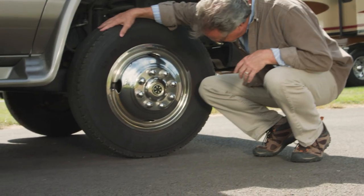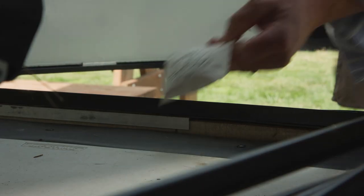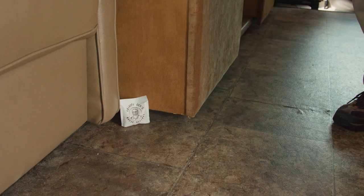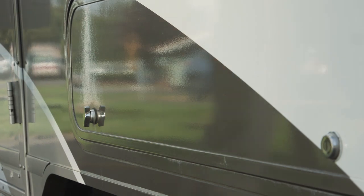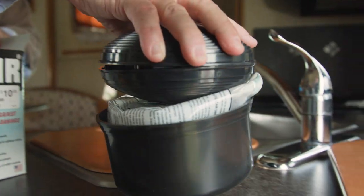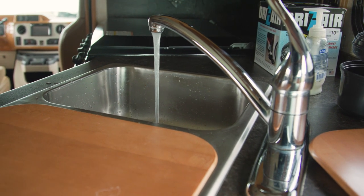Don't forget to properly inflate your tires. Place a rodent repellent bag in every cargo space, and put a few on the inside of the trailer as well. This will help keep rats and mice out of your RV and might help keep them from chewing on your wiring. You'll also want to add a moisture remover to the inside of the RV. If your RV has water filters, remove them or bypass them.